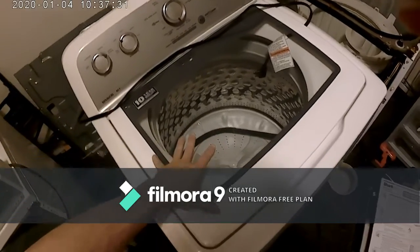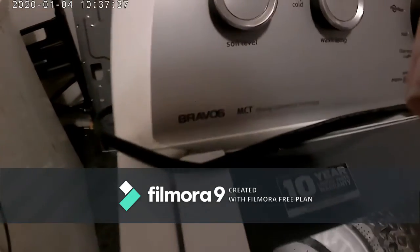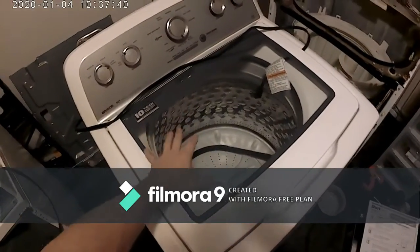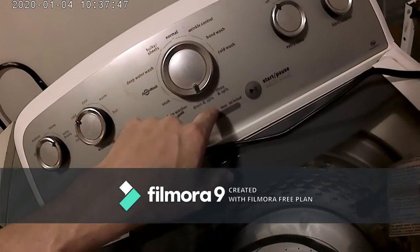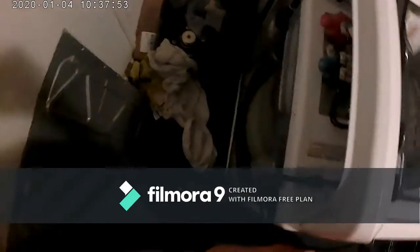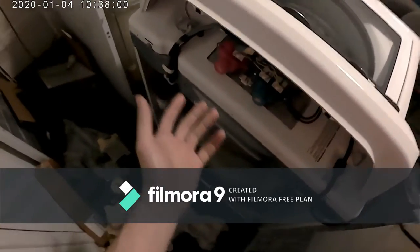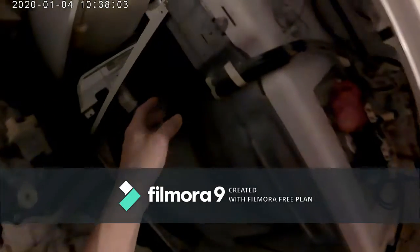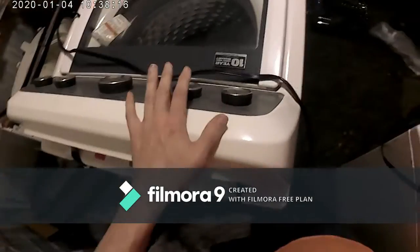I've been trying to figure out this one — it's a Bravo or MCT, whatever it is. It's been a pain. It's not sensing right, so I've been running it on the blanket cycle and trying to get it to drain the water, because it's retaining too much water, but it's not working right. I think it might be the motherboard, but I'm also trying to figure out where the sensor is. I think maybe it's somewhere on this thing here — it might be that green wire in there — but I'm not sure. Still working on this project.